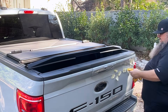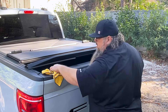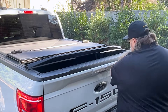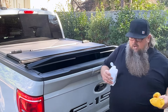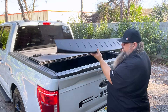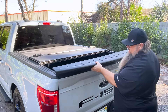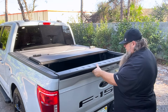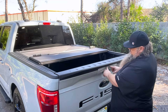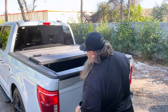You can see I have some masking tape pre-cut. Once we put the spoiler on and align it, we need the masking tape to keep it in place. That's the first step — looks clean. Let that dry for a second. Then we're going to grab the tailgate spoiler. The tape is still protected; we haven't peeled any of that off yet. Set it in place and check your gaps around the factory light and handle. You'll have about 3/16ths of an inch on both sides.